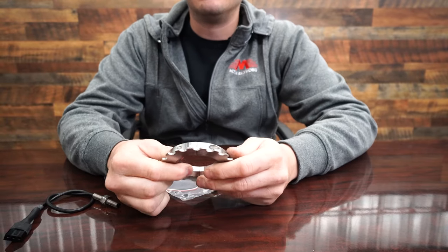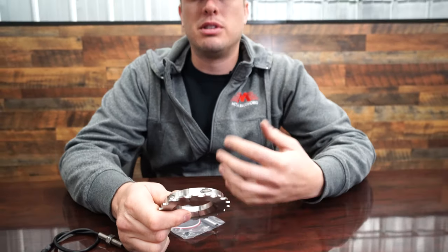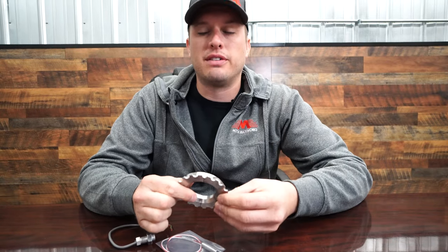The problem is that every once in a while you'll have somebody with a crank sensor or a driveshaft sensor who just can't get a good signal. Everything's square, everything's lined up, the gap is right, and they're just getting a noisy signal. We kind of chased it around for quite some time. A good friend of ours, Glenn Payne from Mad Racing Parts, had a couple customers with intermittent noisy driveshaft sensor issues that shouldn't be happening.